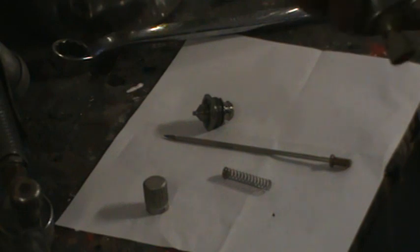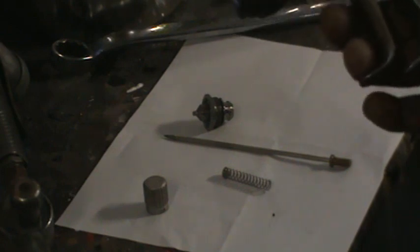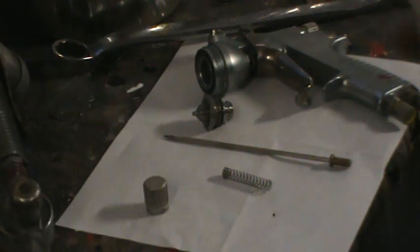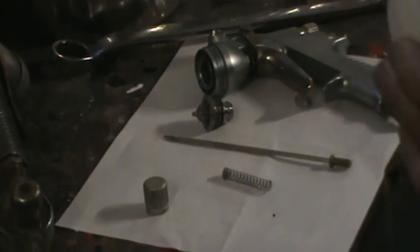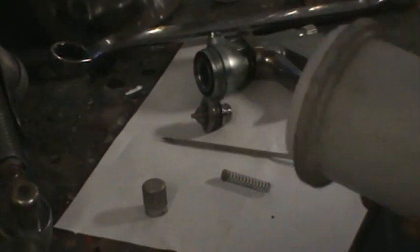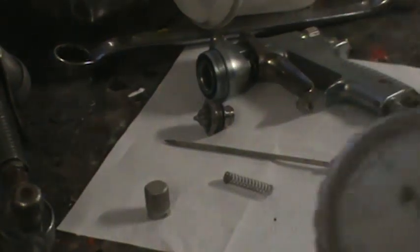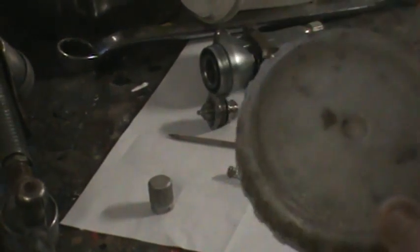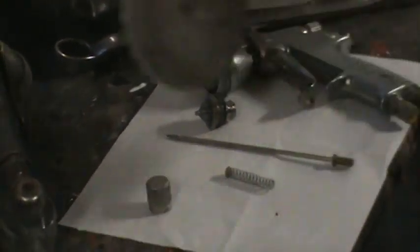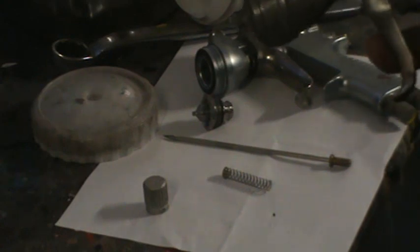The only wear on this gun so far is the trigger - you get that, it's got a little bit of a plating issue from heavy use. It's got a regulator at the bottom so you can plug it straight into the wall and regulate it at the gun for fine tuning, without needing a separate regulator. I was commenting about the cup on this gun, but most shop guys are going to go to a PPS cup anyway. The one modification I did - it has a drip valve on top that me and Tom both took out. If that vent hole gets plugged, the gun won't spray - it seems more critical on this one.